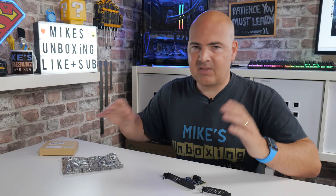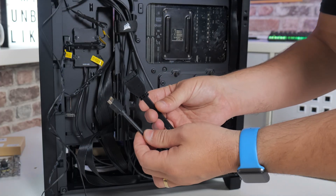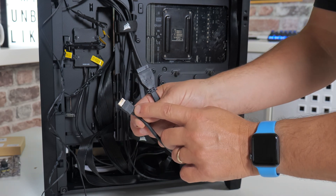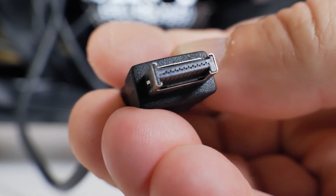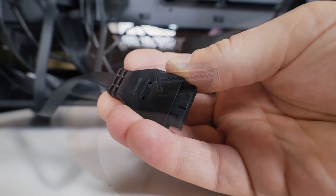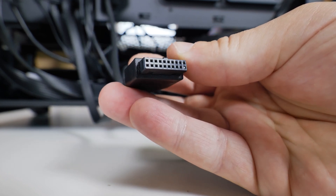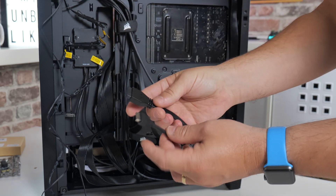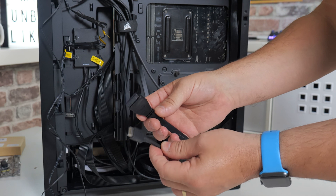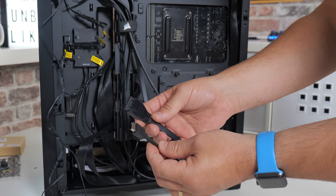So let's do a practical installation and show you how it all works. To get the best out of this card you're going to need two types of connections. This is an internal Type-C connection, often known as a Type-E — it's keyed, so it'll only physically fit in one way. We also have the traditional USB 3.0 port. Both of these are coming wired up from the front of our case. You don't have to use front-mounted panels — you can get separate ones or even DIY a custom Type-C connection if you want to.